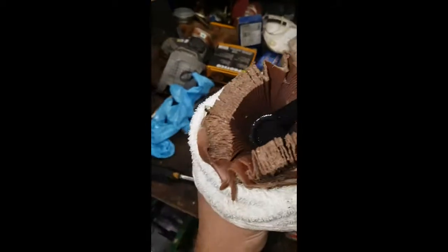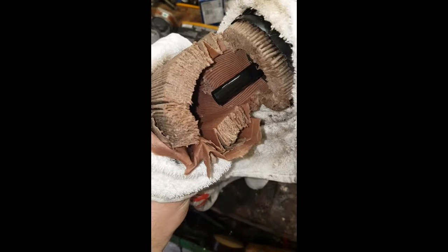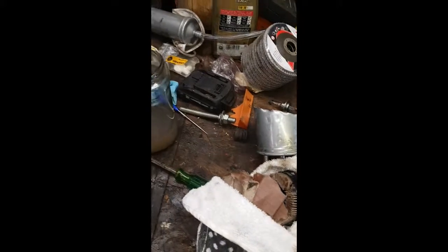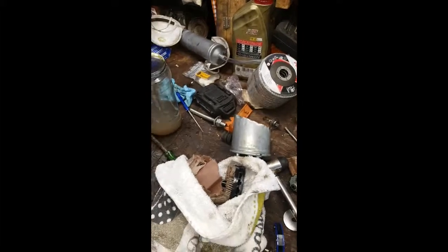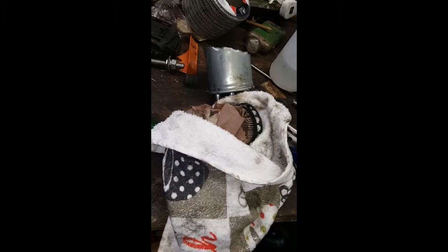I have been using Stardyne fuel diesel injector cleaner — well, it's a fuel system cleaner. Maybe that has pushed all the crap from the lines into this filter, which, looking at it, is a cheapo unbranded one. Maybe that was my problem — the filter just got clogged up very quickly with the Stardyne cleaner cleansing the lines and the fuel tank and whatever. It's a long shot, it might seem a bit thin, but it's possible.